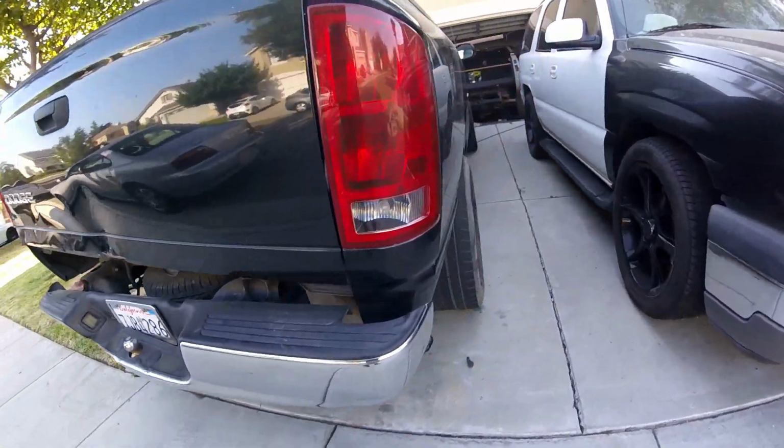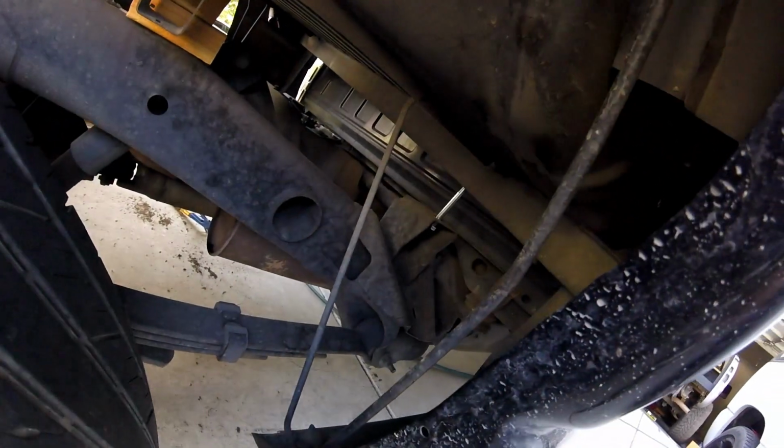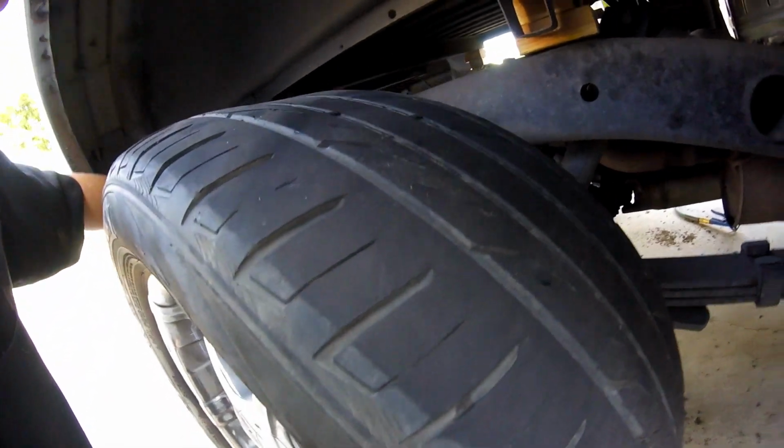You see how far the bed is propped up on that driver's side. Just so you can see what I did, to be safer than sorry, I put these retaining bolts, I think 7 or 9 inches long, half inch in diameter I believe, one on the front, one on the back. I had one in the center, already took it out. I just wanted you to see, so when I pivoted up on the passenger side, the bed wouldn't slide off. These kept it in its place, and they really worked well. Served their purpose for sure.